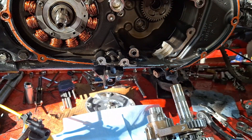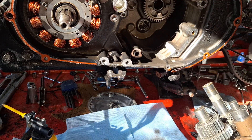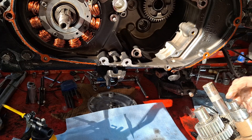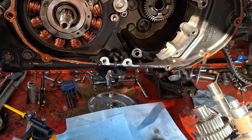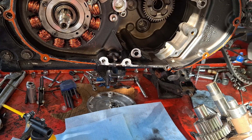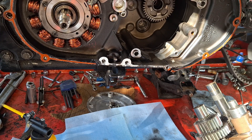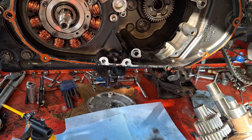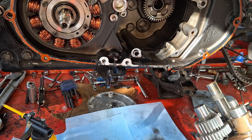And that's our transmission there. This one is really jumping out — that's second. That's third. That's the first gear right there — that's first. The dog's there. I'm going to have to pull it apart so you can see it; it's right on the edge of the dogs. I'll have to pull it apart to show you what a dog is. Dogs are little things sticking out on the gear towards the side. Those are dogs, and when they slide, they go into a pocket.